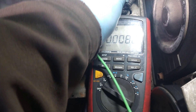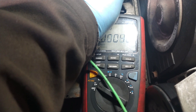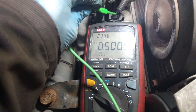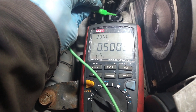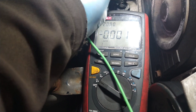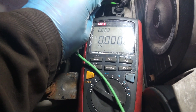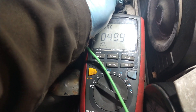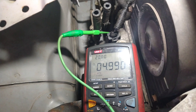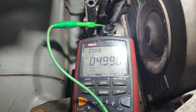The problem with this car is the signal never changed, so I'm going to see what's going on. 0.5 volts with the ignition on at the signal wire — that's about right. The center one is the ground at 0 volts, and the last one should be the 5-volt supply — reading 4.9 volts. So it looks like I've got everything that should be there at the sensor.